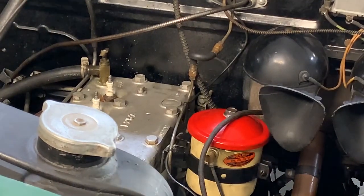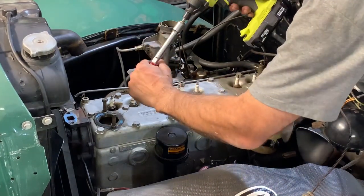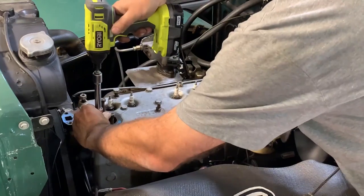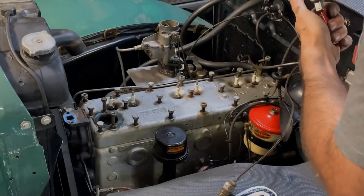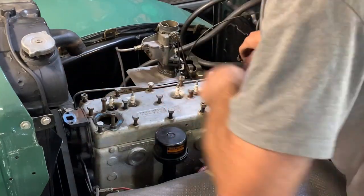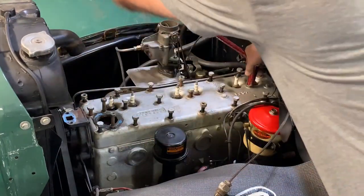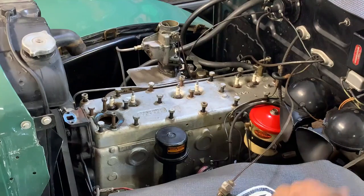The cylinder head is going to pop out all the bolts. Now, in the past, I have used a breaker bar and actually broke a head bolt. So we're going to use an impact here. Nice little Ryobi. Try to swivel up the back here. Roll up one. Put a ton of force on there because you'll do what I did, rookie move, snap the bolt head off. I'm not going to do it this time though.